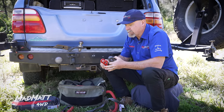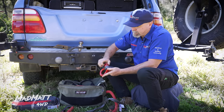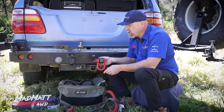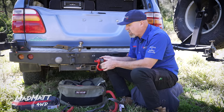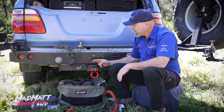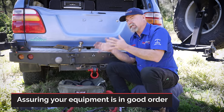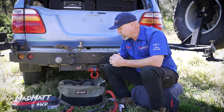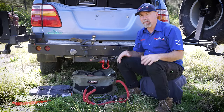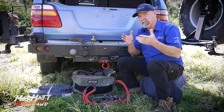You can also use these hitch receivers with a rated bow shackle — the bow shackle goes through and connects, and that is also an excellent rated recovery point. You might say you don't want a chunk of steel flying at you, and that's fair, but given that you assemble it correctly, this is not going to fail in a kinetic recovery assuming you're doing it safely. There is so much more subject matter I could cover but we would honestly be here for hours.